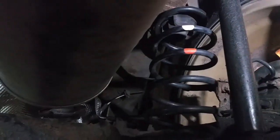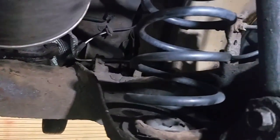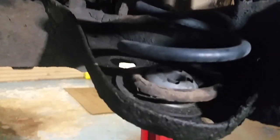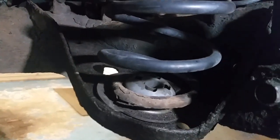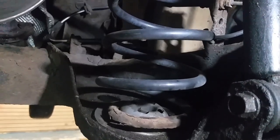So there we go - that's our last wee turn. Springs usually break at the bottom, especially at that wee pigtail there. You see where it all starts to rust at the bottom. It would have broken there probably at some stage anyway - that's where they usually break. They don't normally break at the top.